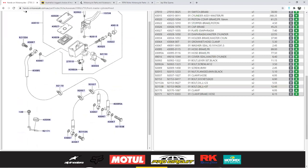Sometimes the lines are just a representation. So for example, this line here doesn't show where it goes. It just says that, hey, this is one end of the hose, this is the other end, and this is the same hose, and there's a clamp in the middle. So rather than just drawing the whole hose in there, which doesn't necessarily dictate the shape of the hose or the installation location of the hose, it just says you've got two ends to that hose. And for ease of interpreting the drawing, you've got the one bolt going through one side, but if you try and put that up here somewhere, you're going to end up with a messy drawing. So they've just done it to say, hey, this end is where it goes in, this end is how it's assembled, and it's easy to just follow where everything goes.